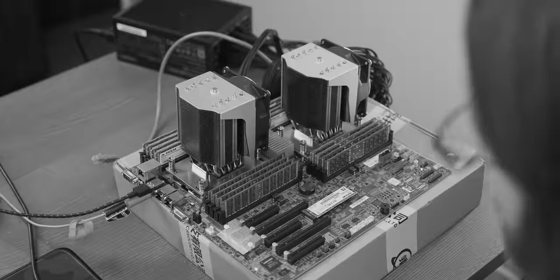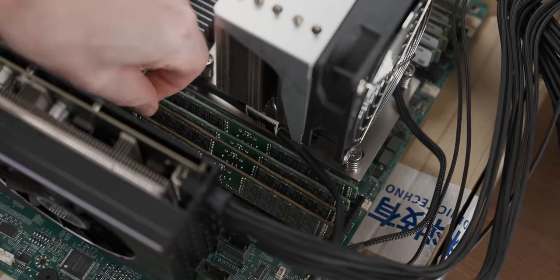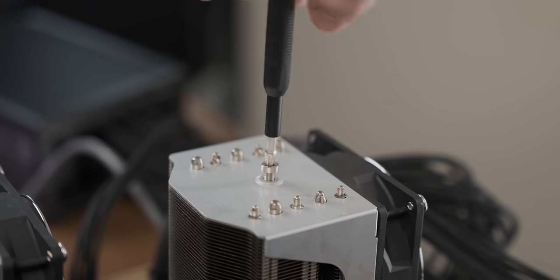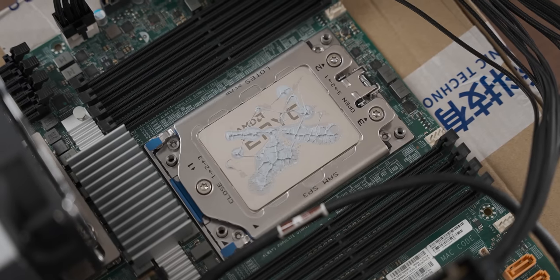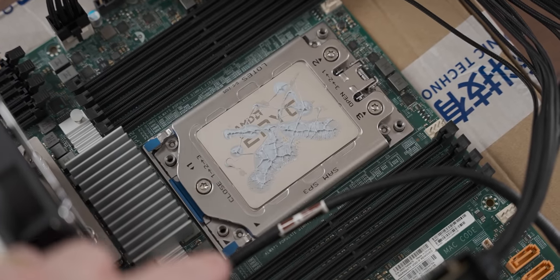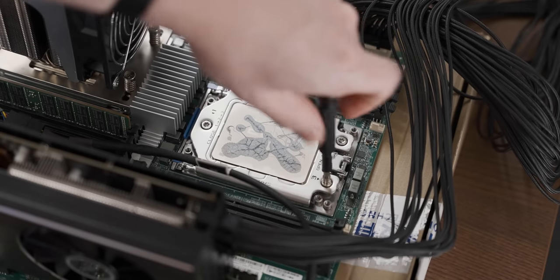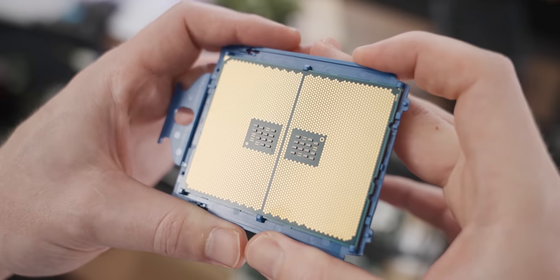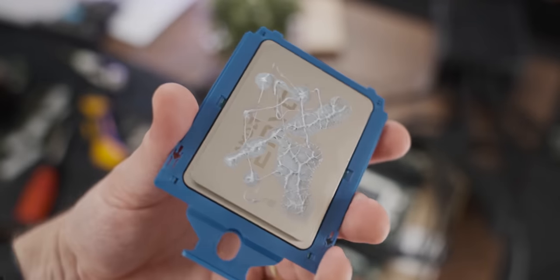With desperation growing I even consulted the manual like some kind of loser, but I still couldn't get it running. I decided to go through the definitely-not-tedious process of removing all 16 sticks of RAM and CPUs to see what wasn't working. I clearly need to rethink my thermal paste application — that is not ideal, although that wouldn't be why the system isn't booting; it would just make it catch fire while running Cinebench. Let me remove the CPU and try with just one.